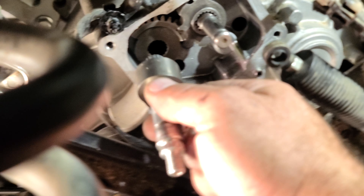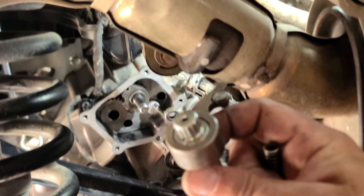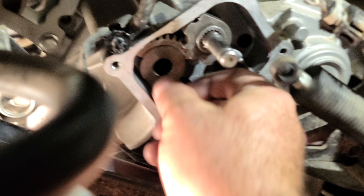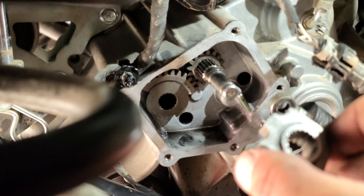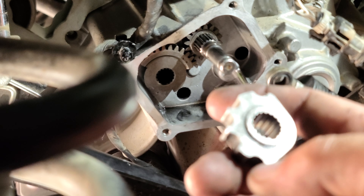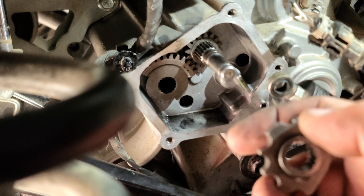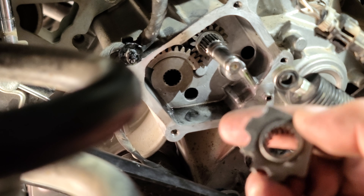This is your shaft here — it has a keyway so you can't mess it up, and it does have a flat spot right there. Put the spring aside. This gear also has little dots. These are your detents for the different gear selections: high, low, park, reverse, neutral, reverse, park. Those should be your detents.